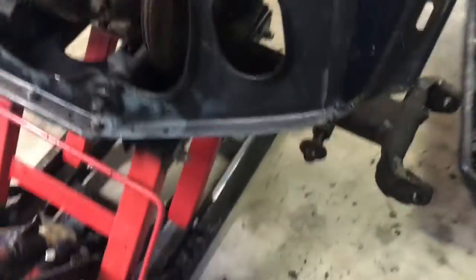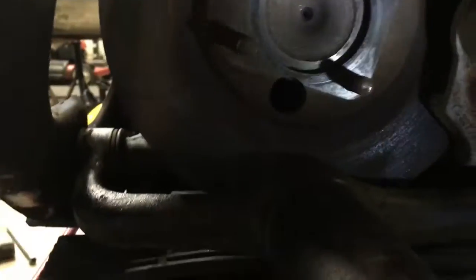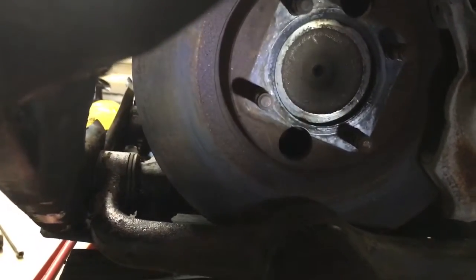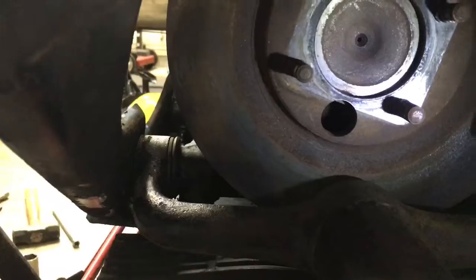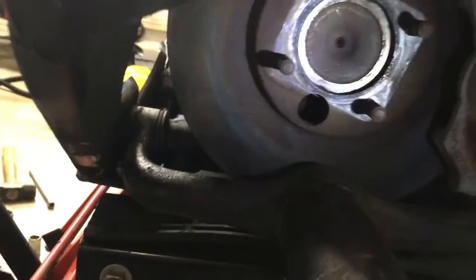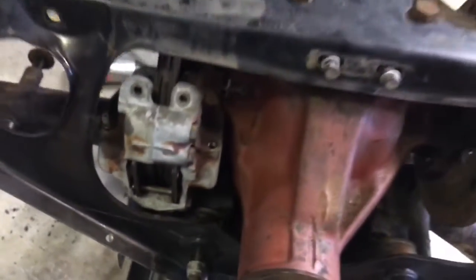Oh, I know what I was going to tell you is that these bolts, the nuts that go on here, are supposed to be steel locking nuts and not nylocks like we have on here, because of the heat. What I'm going to do when I replace those is use stage 8 locking fasteners. They have a camshaft lobe looking tab that goes over the bolt, and then it's held in place with a little C-clip, so it physically locks the fastener in and it can't spin off. We had a hell of a time with Blaze's MR2's turbo downpipe loosening up. We used those and boop, never had the problem again. So we'll do that because that's a lot better. Might do them up here. Not sure about the brake calipers, but we might think about them there too.